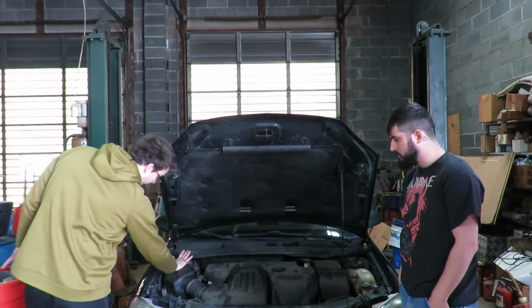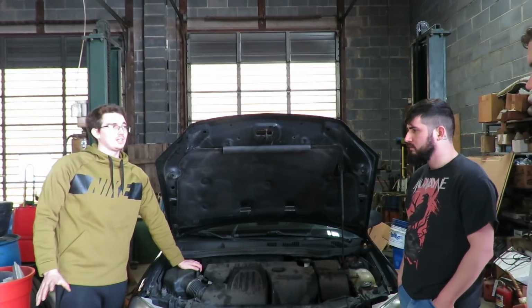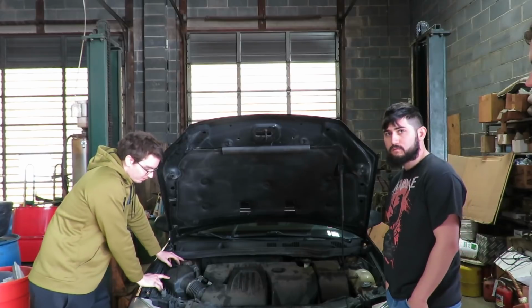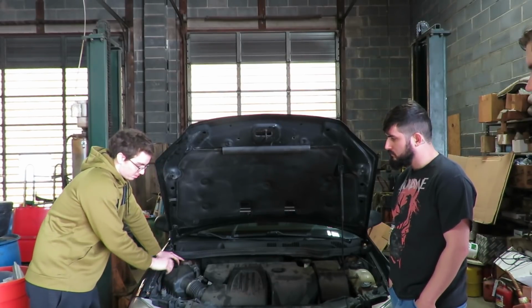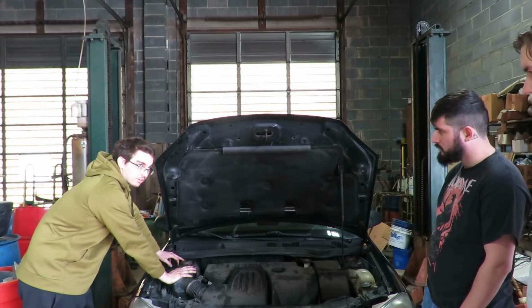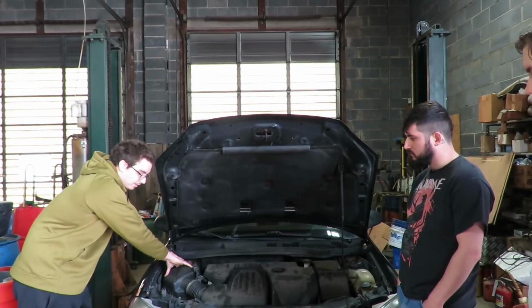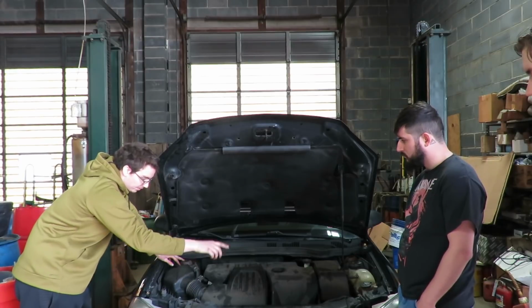Air filter, whenever they try to sell you it, it is key, it is very important, but it's pretty easy to get to yourself. They say the air filter's dirty and clogged up. Look at it. If it's dirty and clogged up, replace it, because your car sucks up dirt, grime, all that stuff. That filter is there to filter it out. Then you have stuff that goes in your air pump. Your air pump pumps it back in here for your cats.